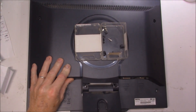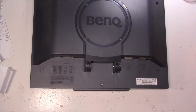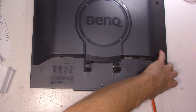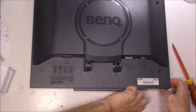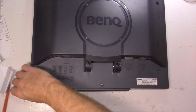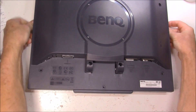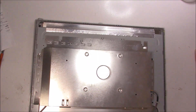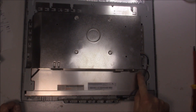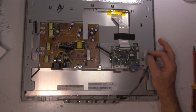Once you pull out the stand itself, there's another screw hidden right here. Right down the bottom are two little cutaways — you'll need to use a flat blade screwdriver to get in there and lever that cover up. It did take me a little while to get it off because it was tucked in there pretty tight, but a little bit of patience and it should unclip and just lift off. You'll also need to remove the VGA anchor bolts, then the whole cover just slides down and comes off nicely. Remove this connector first as well.